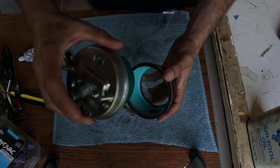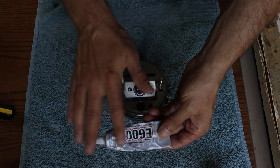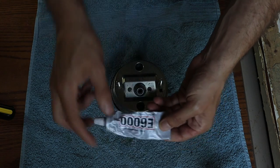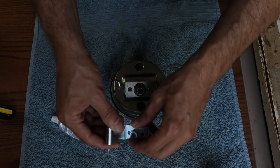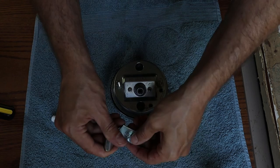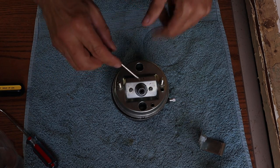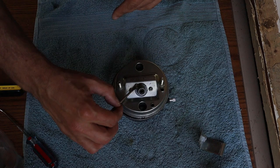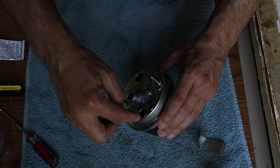For right now I'm putting this together temporarily so I can work with the speedometer with the back facing up and not damage the face or the needle. What I'll do now is take some more E6000 and apply it all in here so that we get a nice fillet in there to hold everything together. I did a test on a scrap piece of metal with a nut just to see how well E6000 would hold — it works pretty well metal to metal.